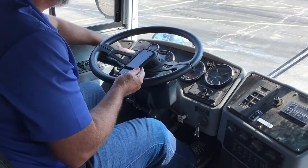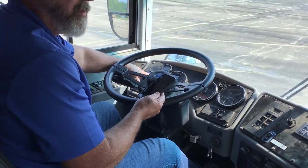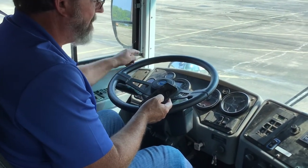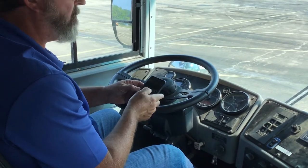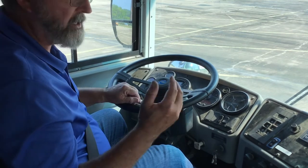So I'm watching my gauges. My gauges are not moving, and for the purpose of this video, we're going to say that a minute has elapsed and we've lost no more than 3 PSI. I'll stop my stopwatch there, and we'll move on to the second portion of the air brakes test.